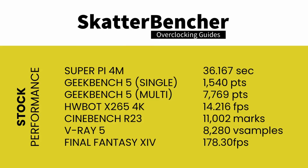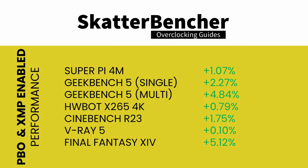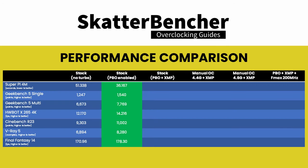Let's jump into the benchmarks and overclocking. First, let's look at the scoring at stock settings. We re-ran the benchmarks to check performance compared to default operation. By default, this motherboard has Precision Boost Overdrive enabled — I quickly disabled turbo in the BIOS to check the performance difference. Precision Boost Overdrive is quite the treat when it comes to out-of-the-box performance.